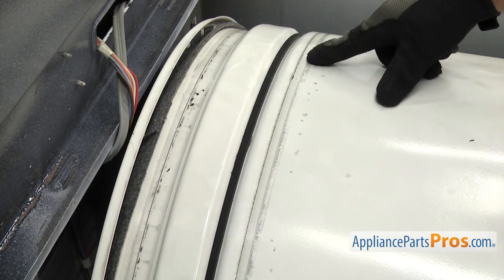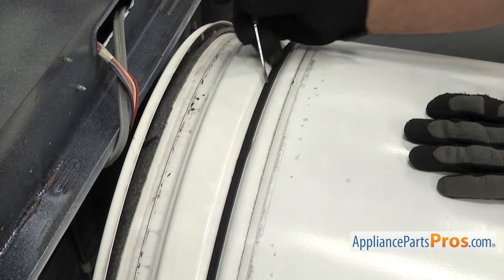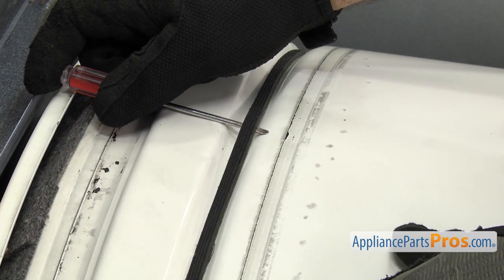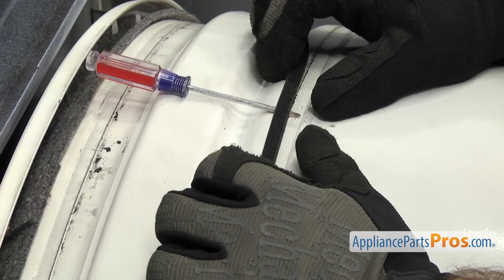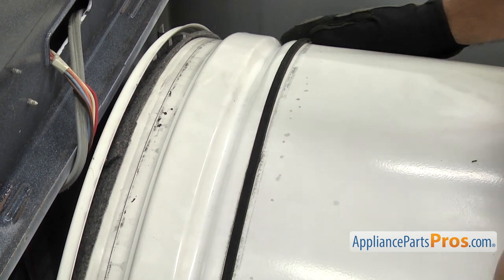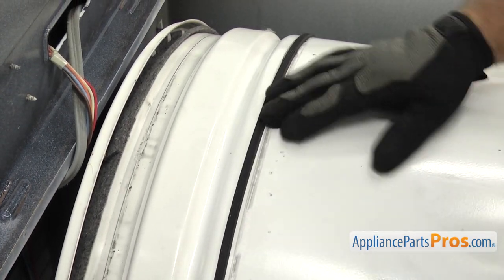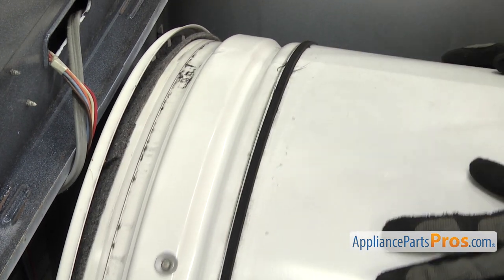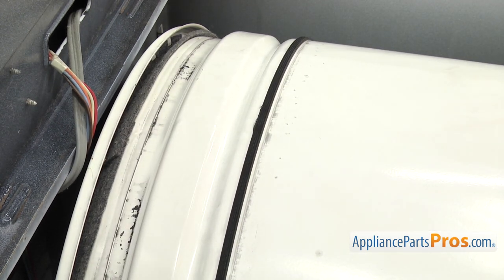Now that we have the top up and supported, you can see the wear mark where the belt is supposed to be, but it slipped up and fell into the groove. We're just going to take a small flat head screwdriver and carefully get underneath the belt and lift it up and then pull it back over the wear mark. Just want to follow it down all the way to the sides of the drum as far as you can. Then turn the drum and make sure the belt stays on the wear mark. Once you're sure you have it centered on the wear mark, we can put the dryer back together.